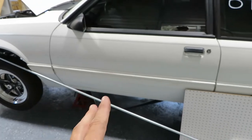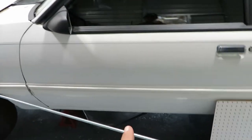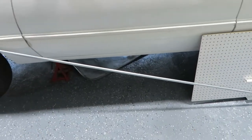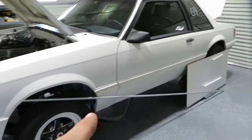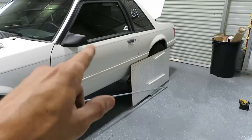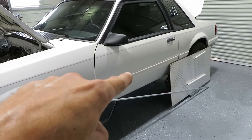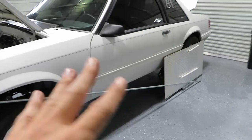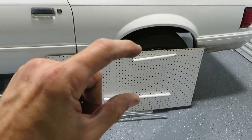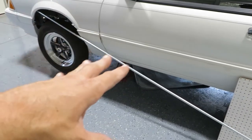The anti-squat line intersects at the center of gravity. The center of gravity could be here, here, or here — we don't know exactly. If you scale your car and do a little math knowing how much weight is on the front and each corner, you can figure out where your center of gravity is. When you lower the car, these two lines that were meeting way out front will now meet somewhere closer — which is below your anti-squat line, and you don't want that in a drag car.